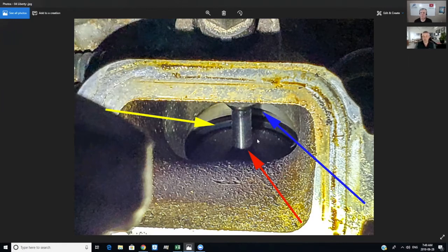The piston comes up, smashes the valve. And I think in this case, what happened is this all happened probably in one fell swoop and broke the timing chain. So these arrows here, the red arrow, unfortunately, this isn't the greatest picture. It's a smartphone picture looking down an intake port, which is a couple inches away from where the camera is taking the picture.